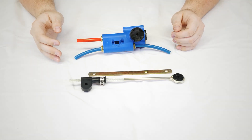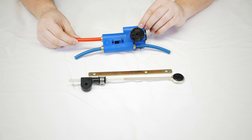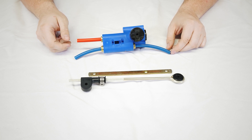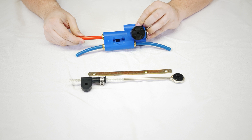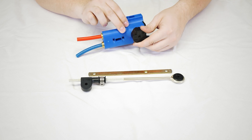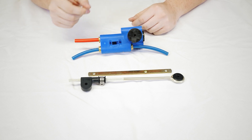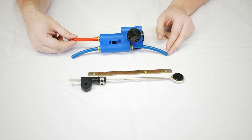If your height control valve is not receiving air or not delivering air to the air springs, check that your height control valve is receiving air pressure and that there's not a blocked line going to or coming from the height control valve. If your air springs are filling but they do not exhaust, check that your airlines are connected in the correct places — these could be swapped, or the valve cap may be aligned 180 degrees out. If your suspensions are leaking down in a short period of time, check that the height control valve and airlines are not installed incorrectly or that there is a leak in the system beyond recommendations.